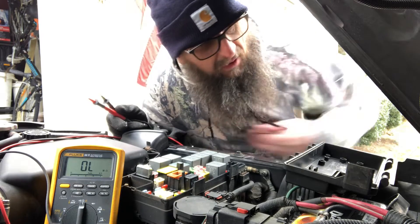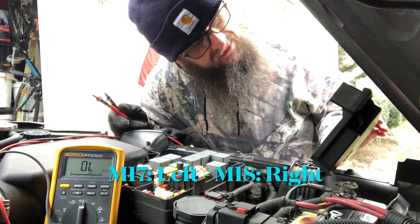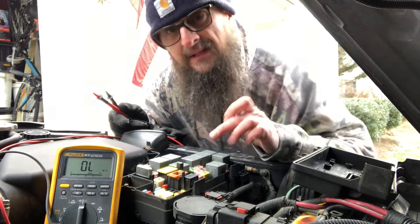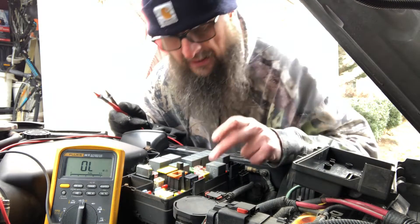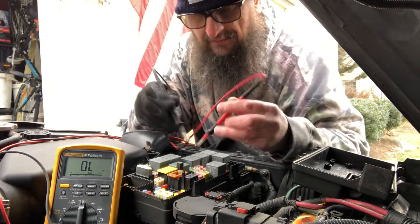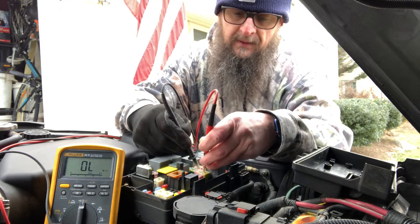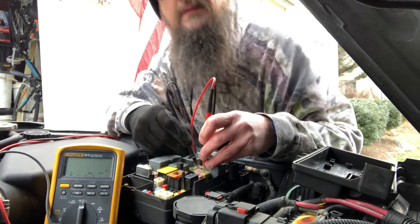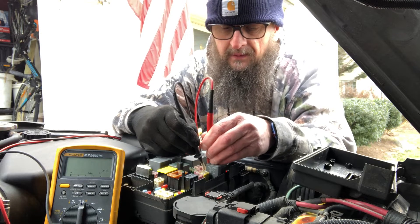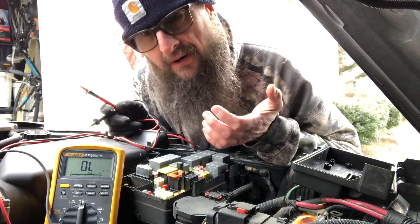On this Jeep, they are in the panel. It's M17 and 16, I believe. They're basically right by this one relay — the two 15 amp fuses sitting here. If I do a continuity check on these fuses, the meter reading shows that one's good and that one's good. Fuses aren't the problem.